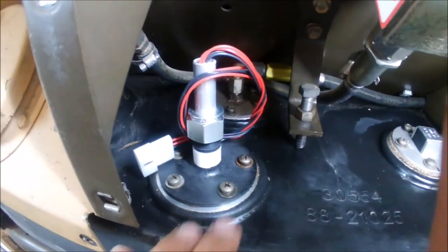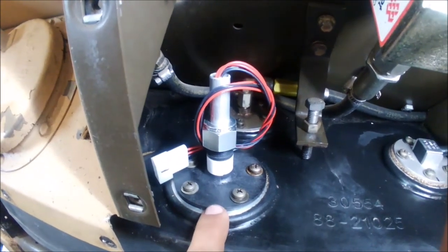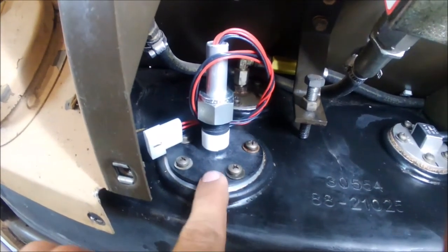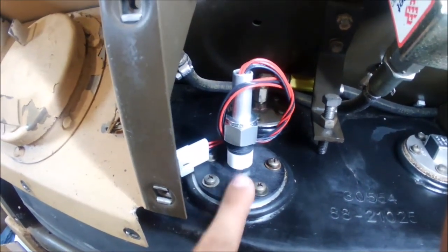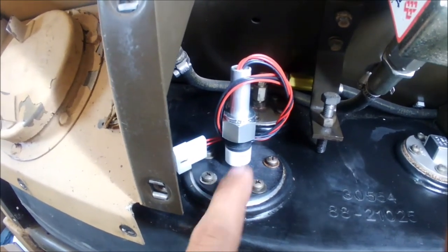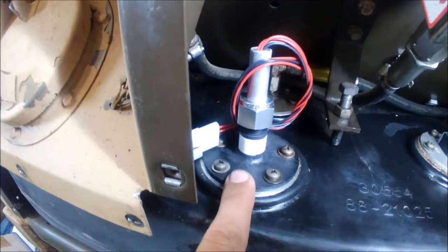Alright, just tighten up the screws. Before I go any farther, I'll leave you some notes on mistakes I made. Again, the gasket: if this used gasket I put on ends up leaking, I'm going to go order them. I don't have a part number for you, but it's pretty universal — if you search for a five-hole fuel sender gasket on Google, eBay, or Amazon, they're like six bucks. They make them in cork and Viton; the cork will probably work fine for diesel, I'd go with that.